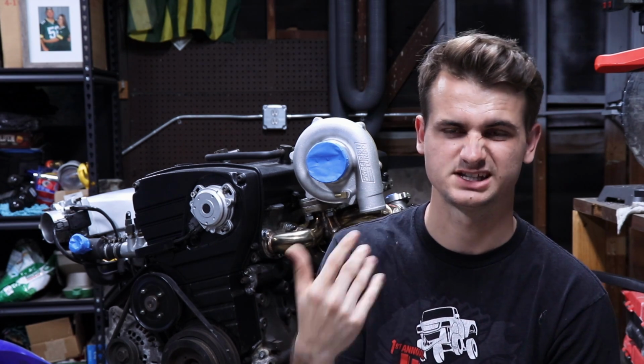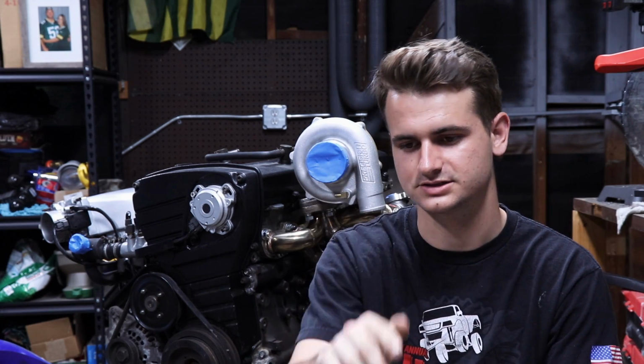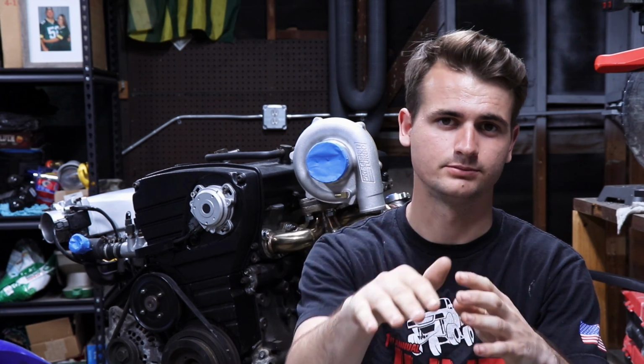But in case you don't know anything about the build, my 240, I take it off-road, I don't drift it. I just take it off-road, have some fun with it. So I'm going to delete the front bumper and have the bash bar, and then we'll build a skid plate from there. And then I have to work around how I'm going to mount the intercooler with a skid plate there. I think I'm going to cut out the skid plate like S13 or 240SX or even like Nismo, something cool. Cut it out, and then put some mesh there, so I can mount the intercooler lower and get more airflow through it.